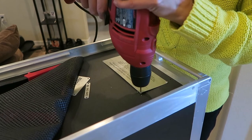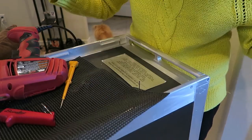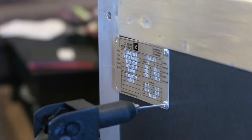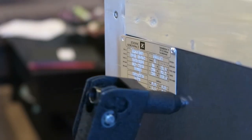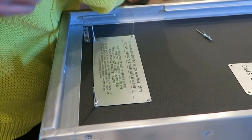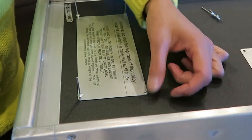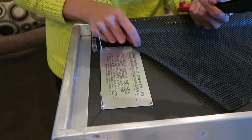In the end it was easier to re-drill the hole so my 1/8 inch rivets would fit. One problem I had is that the riveter would jump out of my hands scratching the vinyl. My solution was to cover the rivets with a shelf mat to protect the vinyl.